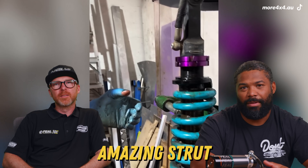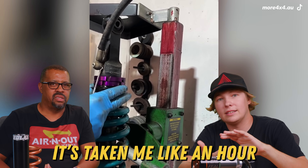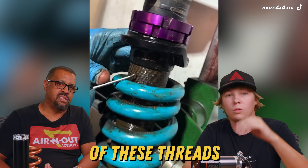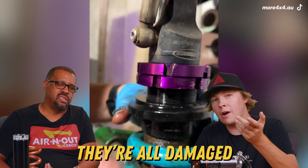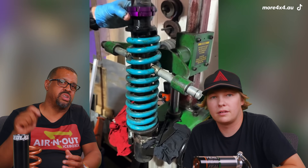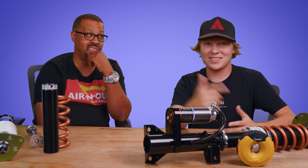Let's see the next clip — this guy's got a good beard, he knows what he's doing. There's so much stuff under here, I can't even think to wind this thread down. It's a coilover that's leaking from the top — we're just trying to clean all the mud out of these threads so we can adjust. That looks obnoxious. You can use a special brush with these bristles. Here's a trick — duct tape. You duct tape the threaded area so dirt can't get in there, and when you want to adjust it you just take the tape off and adjust, then put more duct tape back on. You just taught me something, and I've been doing this a long time.